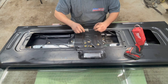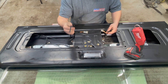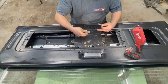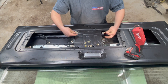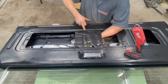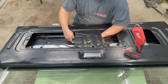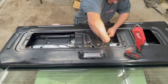Because of how difficult this can be to do upside down, the best thing I can suggest is to plug this in first underneath and then work on the second one after that, so you can make sure it's out of the way. When you run the wire under that rod that goes straight down with a 90-degree angle at the bottom, make sure the wire is run on this side of it — if it runs on the other side you will pinch the wire at some point. Now I'm going to connect the wires.